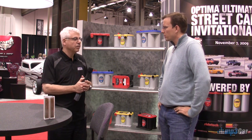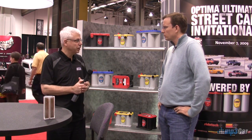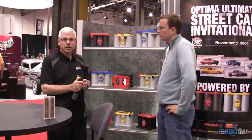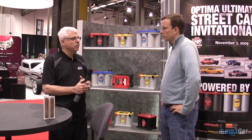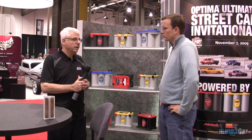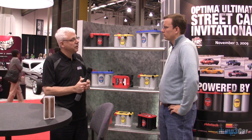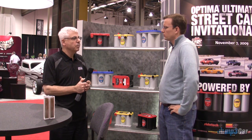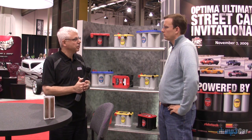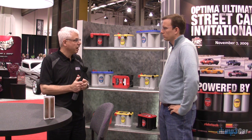The AGM and gel are both sealed. AGM has a lot of advantages over gel in terms of forgiveness over the recharge voltage range — gel batteries are more sensitive. You don't really want to charge an AGM battery using a gel battery setting, even if your charger says gel or AGM. You really want a charger that's a straight AGM design. Many new chargers have specific algorithms to charge an AGM or a wet battery, and if you have the opportunity, buy a charger with a specific AGM-only setting for an Optima AGM battery — that's the best route.